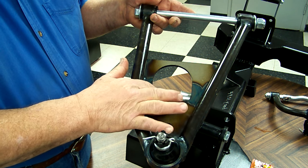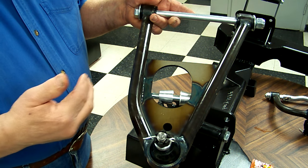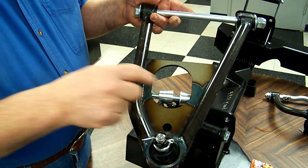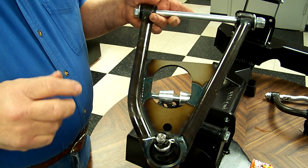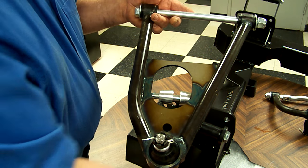The next thing is these spacers that are used on the bottom. Note that there's a taper on them. The small side goes outboard and matches the tab underneath. The larger part goes inside and contains the bushing as an extra safety feature.